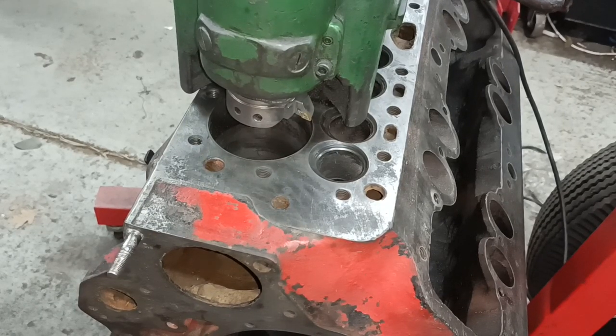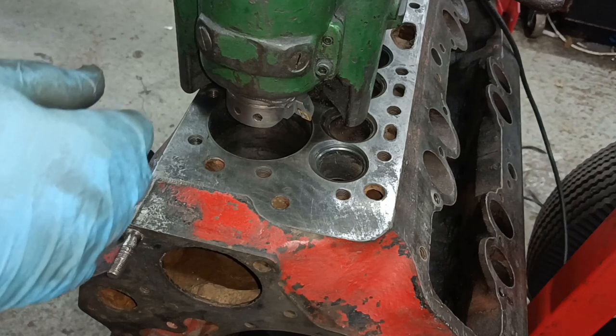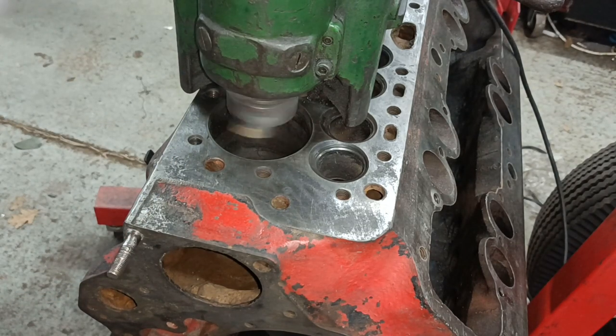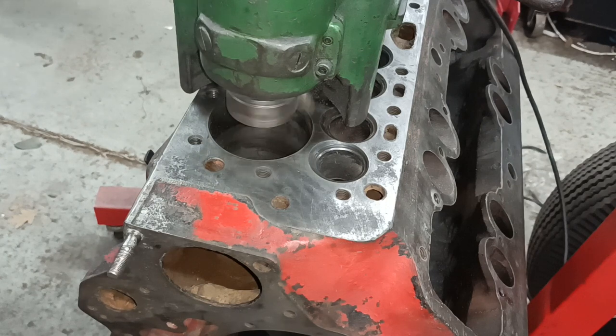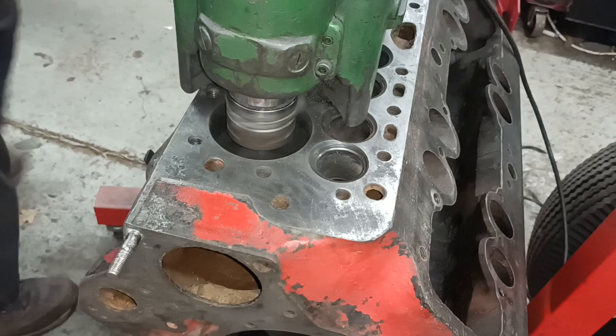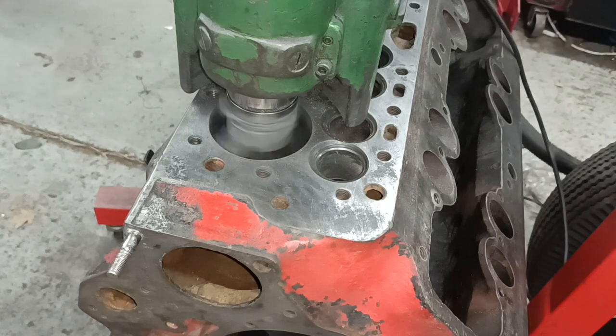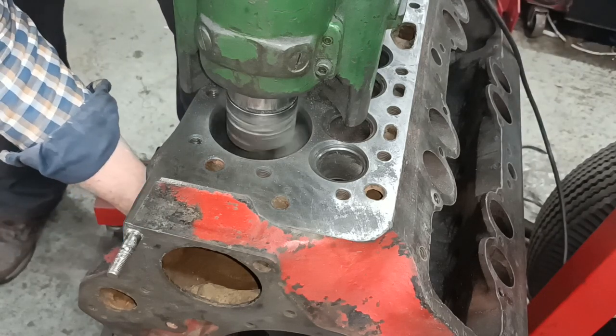So what I'll do, I'll start it running, pausing to think, have I done everything? Everything's tight. Yeah, I've set the tool. That's running, and I'm going to wind the handle to start it down. And when I hear the first little bit of noise, there, I'll back it off and tighten this thing on the side there, and that's cutting there. And what I'll do, I'm going to wedge the vacuum cleaner in the bottom of the bore like that.